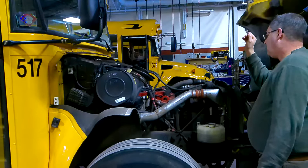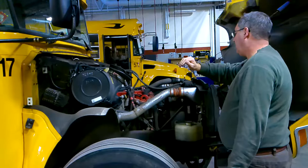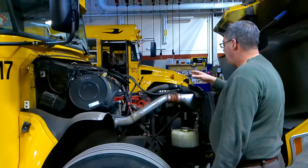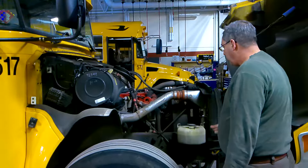I'm going to check and make sure that my coolant reservoir has a sight glass that's between full cold and full hot, so it's in a safe operating range. All the hoses coming and going from it are all mounted securely. I don't see any dry rotting or cracking, and I don't see any leaking from the container or the hoses themselves.